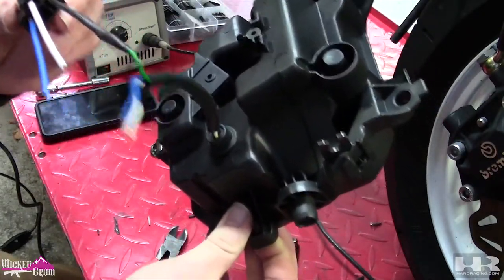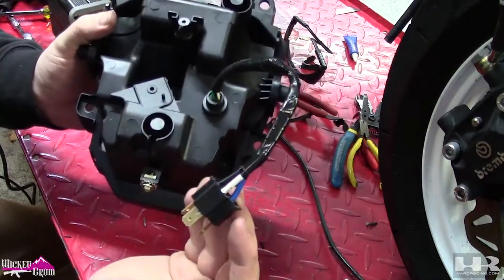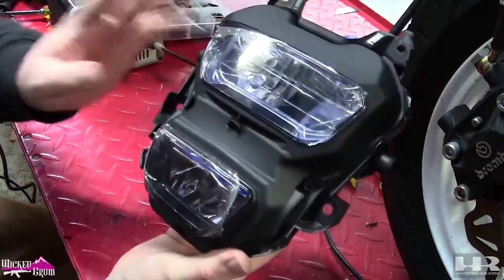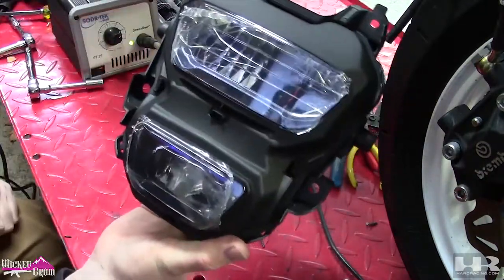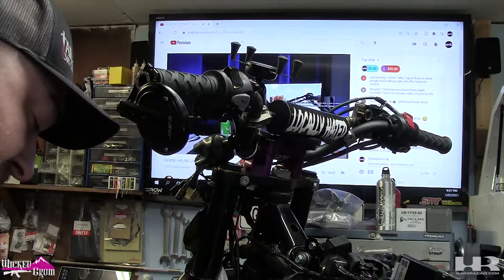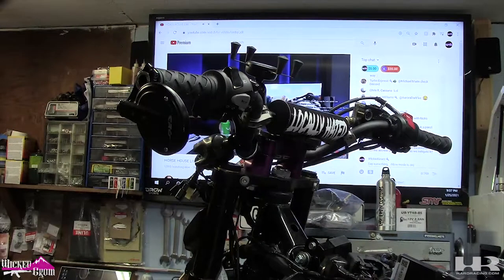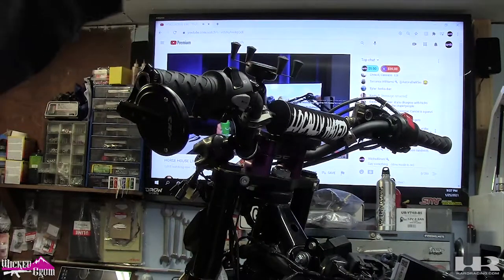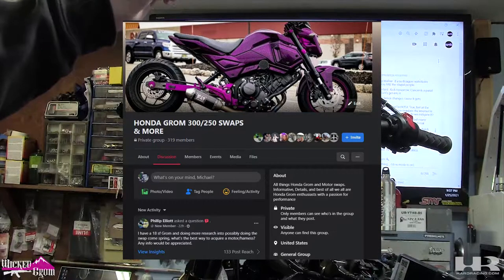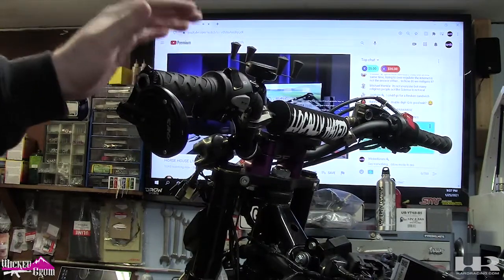Just like that — we have a perfectly plug-and-play 12-volt LED headlight for your SF if you're doing a swap. Next thing we're going to do is switch out these controls. I believe I said in the beginning I was going to try to re-pin these. There is a way to re-pin them — I'll have a diagram in the Facebook group, which is linked in the description. For now I'm lazy, I'm going to put my 300 controls on because it's plug and play.